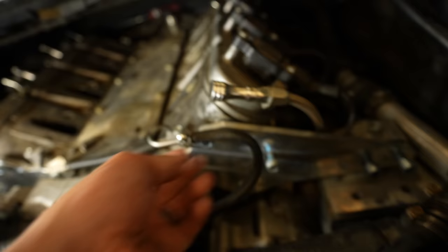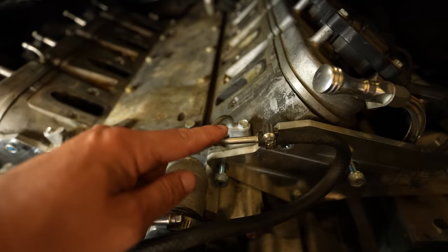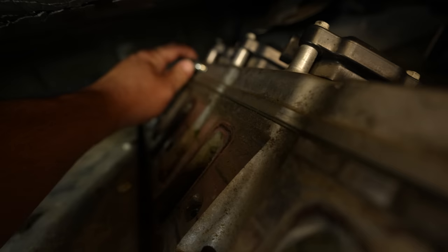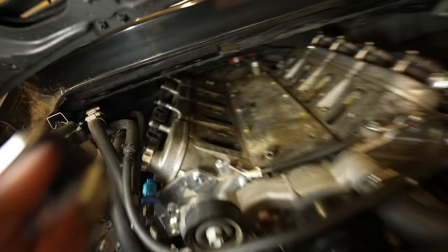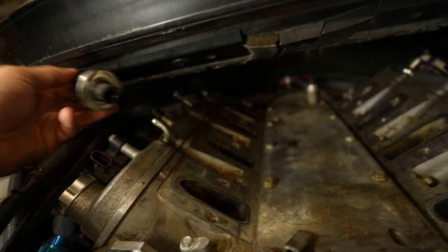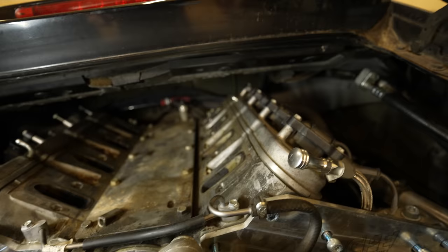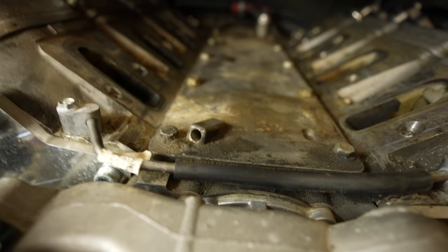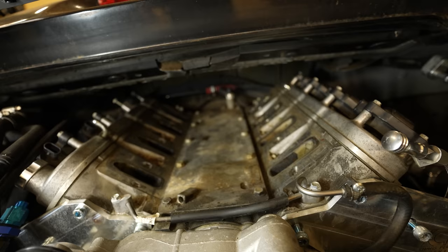This hose here is for the steam port and it just looks awful - it's all kinked up. We'll get rid of that and run something with aftermarket lines. I have this huge pet peeve with vacuum caps - there's a vacuum cap here, so I'll probably pull the valve covers off and weld these. This is what we have for crankcase vent - just looks super cheesy, so we'll get rid of that, weld that hole shut, and weld some actual breathers onto the valve covers, or AN fittings so we can run a catch can. This vent here is just going to the intake - again looks super crappy. That looks like 1/8-inch MPT will probably thread into that, so I'll put a fitting there. Everything's super dirty, so we'll clean it all before we put it all back together.